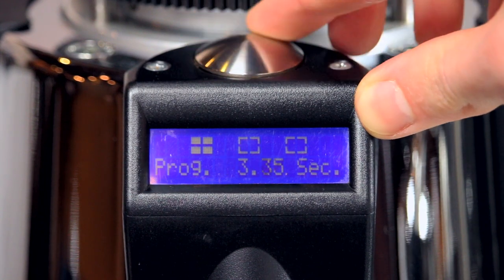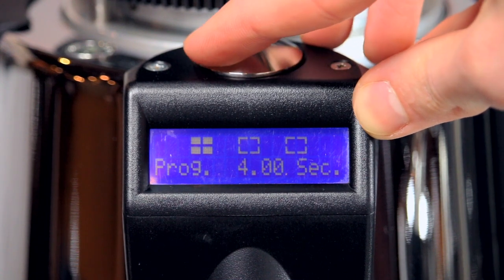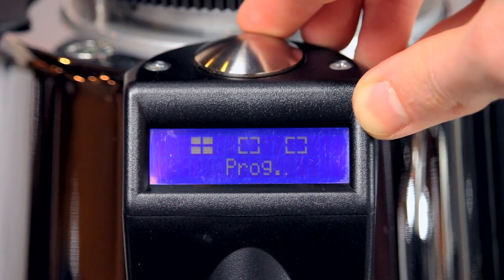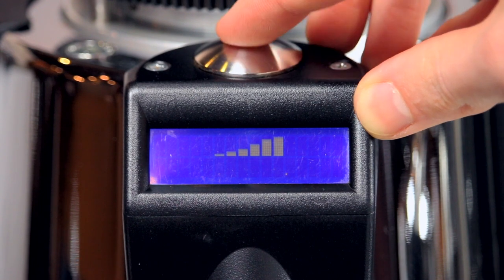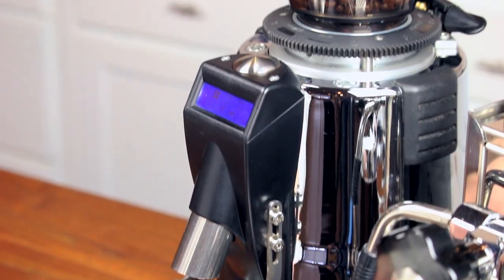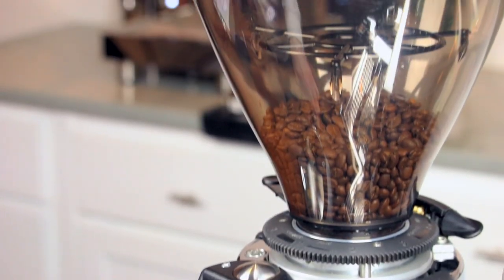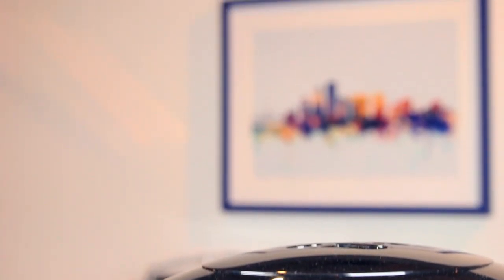Pressing the button on any of them will allow you to change it. Let's go to the first timed dose and change the time to 4 seconds. Press the button again to save it, then rotate the dial counterclockwise to the exit and press the button. Tare your portafilter, grind, and weigh the portafilter again. If the dose is too small, increase the time setting by a few tenths of a second, and if it's too much, then decrease it.